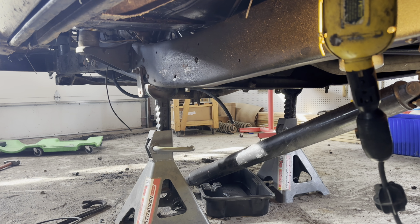Well, let's go ahead and put on the grinding wheel and take care of that old weld. And then on this one, I might only drill one of the holes on the bottom that it wants me to drill, because I think I'm gonna have to re-drill the hole that mounts on the frame over here on this bracket. So it will have two. And I previously had the rear, or the transmission crossmember, back here. And I'm not going to drill another hole back here because I don't want that many holes in the frame to create a weak spot.